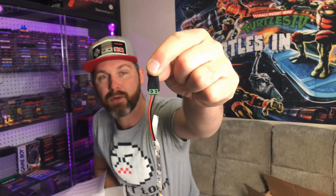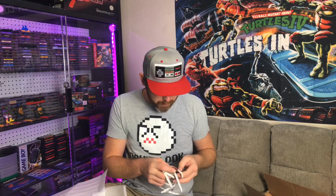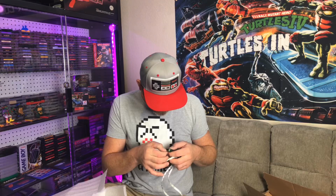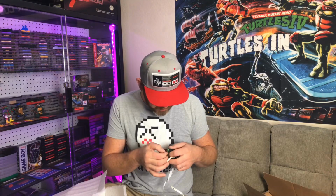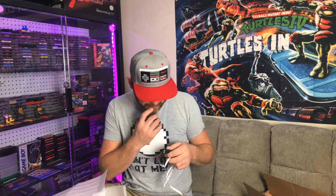And then as you can see, this LED is about 2/3 of what that other strip was. So I don't think they measure their LEDs out. And this one was done, this one's wired in a lot nicer, if you can see that. No exposed wiring. That other one looks like it got pulled on or something. This must have been a Friday order for sure. But yeah, there's enough exposed wiring on those two that they could touch. So I'm going to back the screws out, shove them in there further, and pull them back down so they don't short out on me. Now for the second marquee.